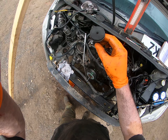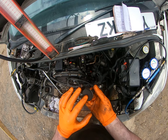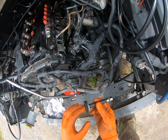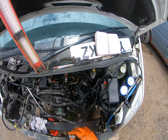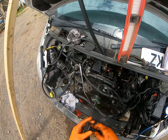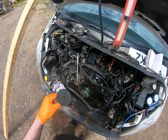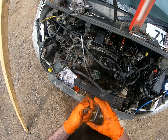It's a little sealed face — like a little sponge face — that fits over the port. If we are getting any leaks, it's going to blow down and alarm us through this whistle. We'll also fit one over the exhaust tailpipe which will tell us if we've got a leaky exhaust valve. So we'll show you this test.